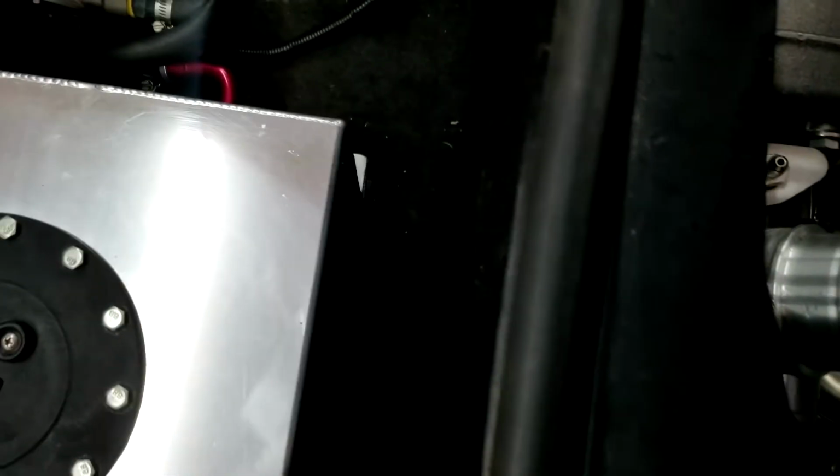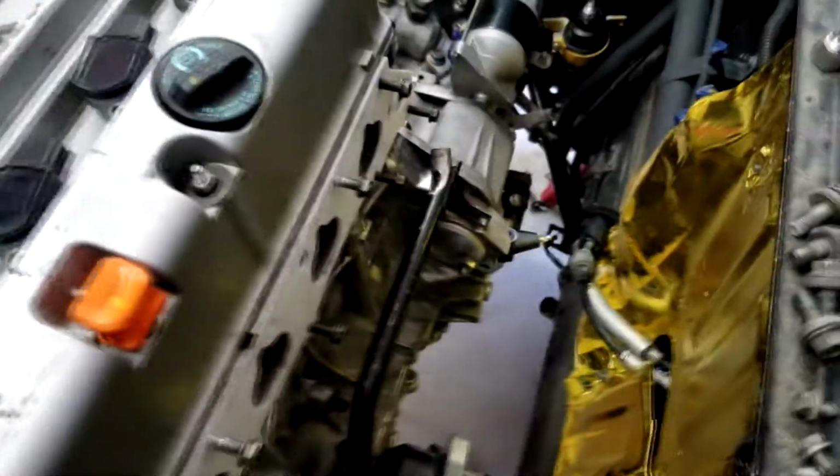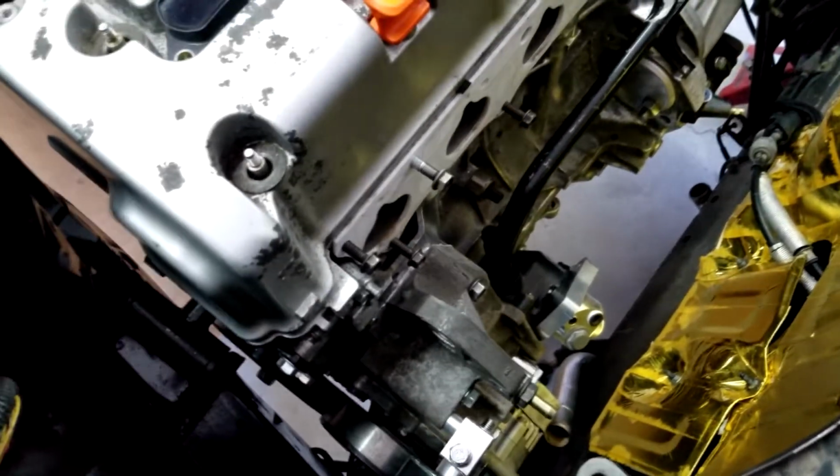As you can see, this wall is straight up. The intercooler is going to be mounted directly on this wall right here, and this 90-degree that's coming straight off of this turbo is going to go straight into the intercooler. I probably wouldn't even have a pipe, just a straight coupler to coupler. And on this side, it'll come out straight into the intake manifold. And yeah, it'll be easy. It'll look kind of like my setup. So yeah, it's not very hard. The only other thing, if you're doing this, it'll make it a little easier to have a load leveler, of course.